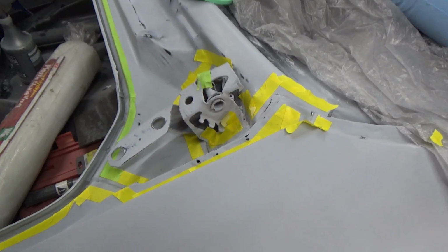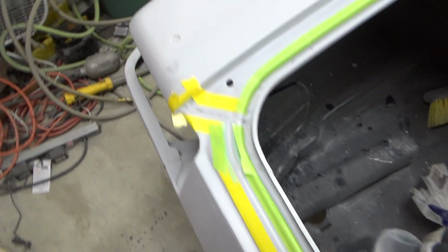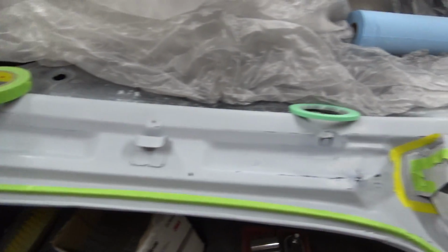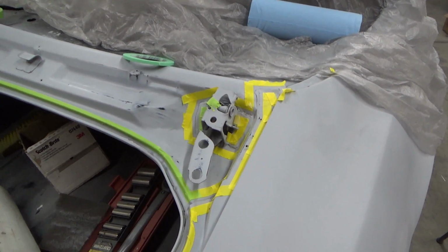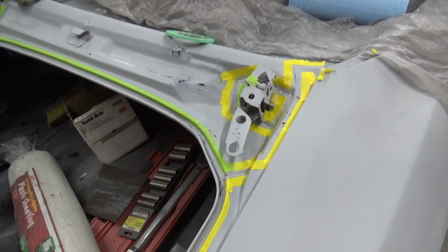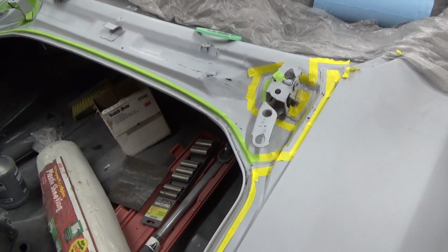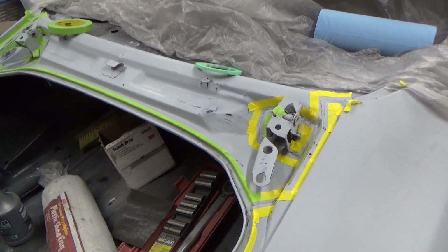As with anything else in these projects, you spend way more time masking than you do anything else. So I tried to do a good job getting ready here. I'm going to go ahead and put the seam sealer on, and we're going to keep an eye on it because it dries pretty fast, and once it's dry it's really hard to get the tape off. So Pops is going to follow me along here, and if it's drying too fast he'll start peeling the tape off. If not, we'll hopefully get through everything and then peel it off.